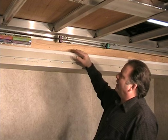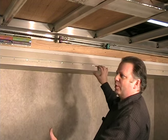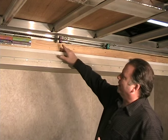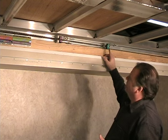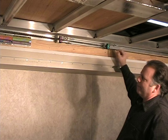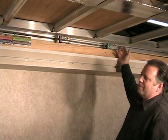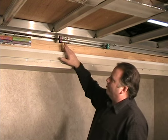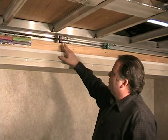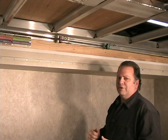Each side of the AccuSlide has four cables attached to it. They operate one side specifically — one's the right side, one's the left side. On the right side, your bracket tree should always have a purple and a green label. The green label says bottom and top — this is the cable that goes to the top of the room that brings the room in, and this cable goes to the bottom of the room that brings the room in also. The out bracket takes the room out — top cable out, bottom cable out. The same holds true for the left side of the room, only you'll have red and blue on your labels — a red out label and a blue in label.